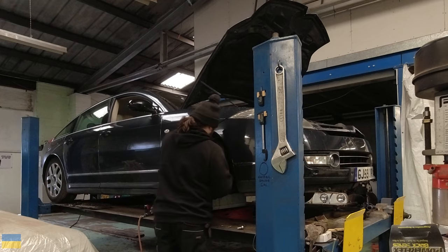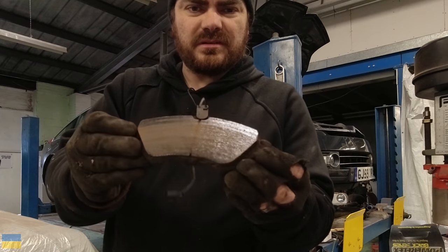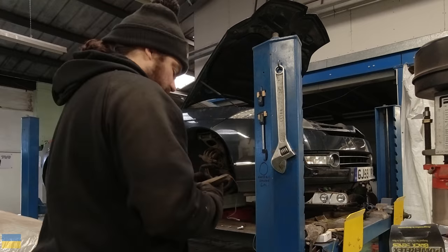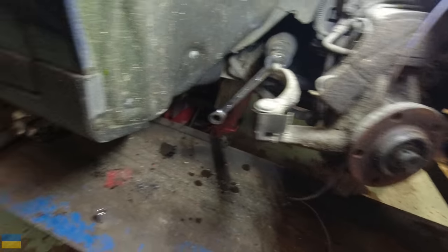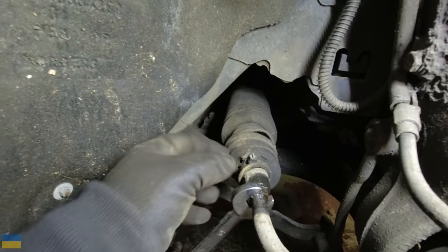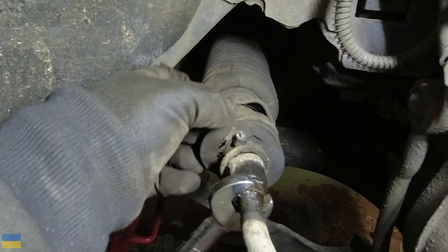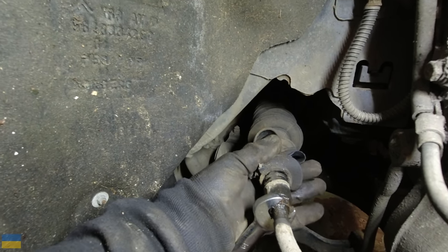There's life growing in my C6. Fair bit of meat on those brake pads, but you wouldn't refit them with new discs so they can be changed. I've just gone to remove the lock nut for the track rod end while the thing's all assembled — the brake disc is off now. But look at this gaiter — that's what it got the advisory on. Last year it was just a bit perished, but now it's split completely. That's a definite fail.